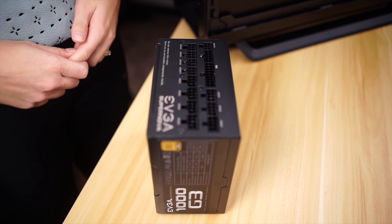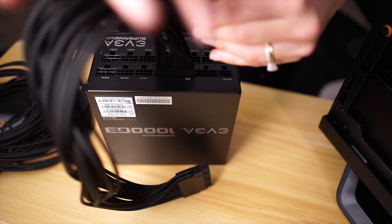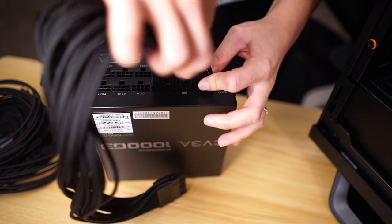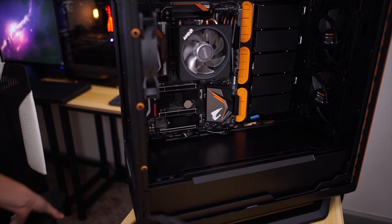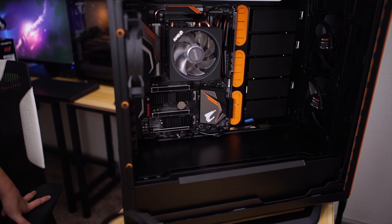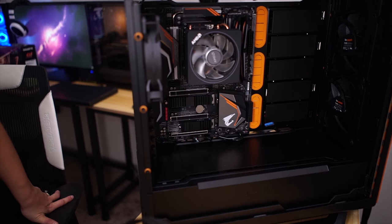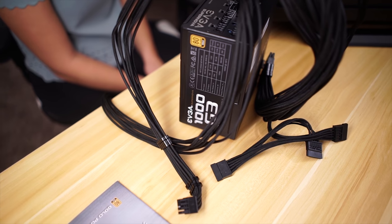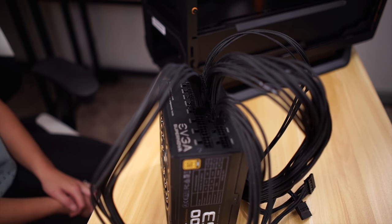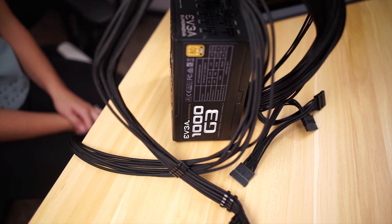So I need cables for the graphics card, and I'm going to need for the motherboard — so I need this one and this one next to it. Just a side note: a thousand-watt power supply is severe overkill for the system we're putting together. You could actually get away with something as little as 450 to 500 watts. Ryzen is actually very power efficient, and the graphics card we're using is also fairly efficient. Total system power under heavy load shouldn't exceed 350 to 400 watts worst case, so optimal wattage would be around 600 watts. We're going 1,000 watt here because it's really all I have on hand and I really like using these custom sleeve cables from CableMod. We'll link a more affordable, more reasonable power supply in the video description.